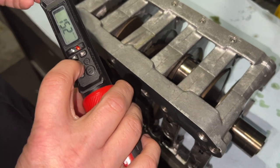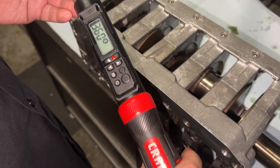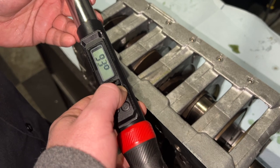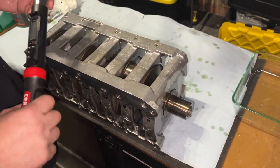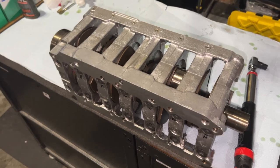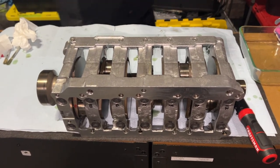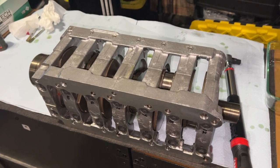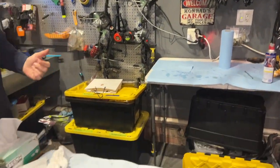110. Okay, so hit that unit thing until it goes back to your angles. On mine it has to sit there for a second and zero itself, but maybe it's already zeroed. So now you can probably go to 110. Oh, one thing we didn't do, and the reason why I missed 13 and 14, again, this is a matter of discipline: we should witness mark every time you throw torque on something. We did not do that, so we probably should. So now each time we do one to 110, we'll mark them? Yep. Since we have already done it, typically what you want to do is witness mark every time you torque. We would not have missed 13 and 14, but good thing we have good record keeping.